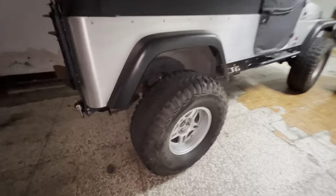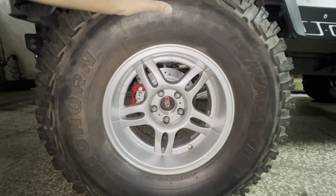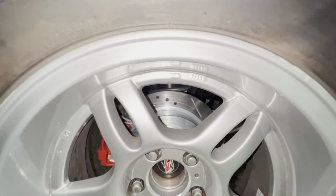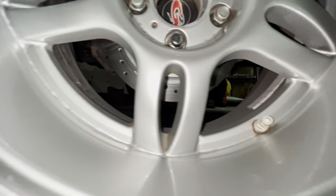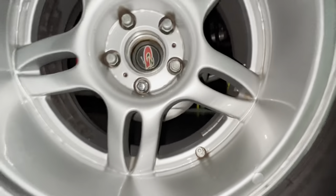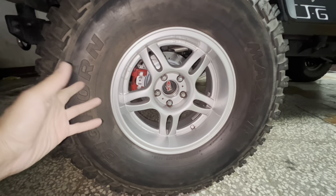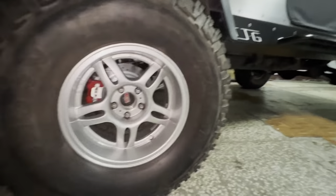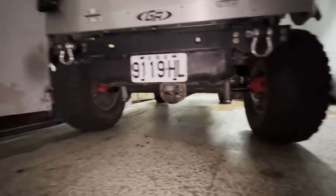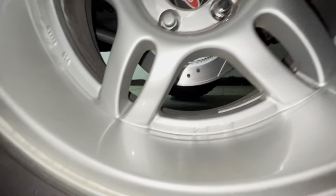Quiet and smooth. The braking process is done. I just went back and looked at the footage — I had my kilometers per hour wrong on the top speed. I was supposed to be going up to 65 and I went up to 60, but I did it five or six times and gave plenty of time to cool down. Other than the top speed being a little short, I exceeded everything the instructions recommended. I got a nice coating on the rotor on both sides. No brake dust, no squeaking or squealing. It's braking fine — the pedal feels good, everything's nice and tight. I'm going to wrap this up and call it a success. Thanks for watching.